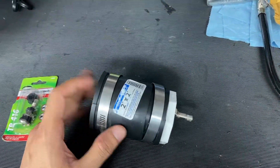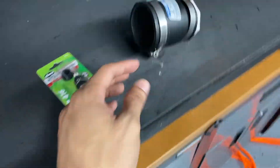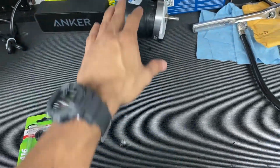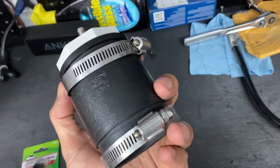I'm not even joking — it is a two-inch coupler. The stock Evo turbo inlet is 2.5 inches, but this stretches wide enough to fit the 2.5 easily; just clamp it down. Make sure you clamp both sides down. If you have T-bolt clamps, that's better, but I just used the included clamps and it still works.